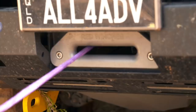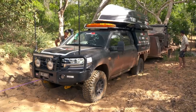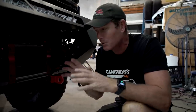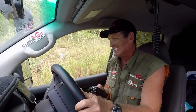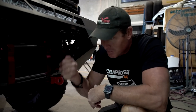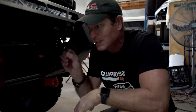Last season we ran the red winch in the 200 and the 79. It's just winding the rope in. Totally impressed with this winch — 17,500-pound winch. It is a killer winch. Its ability to run under extreme conditions. And the weights that we get in these trucks now when we're towing trailers are huge, so your little 12,000-pound winch ain't going to cut it anymore. The fact that it's got extra things like air brakes, air free-spool, remote control, button operated in the dash — all those things make these winches worth the money that you spend on them. They'll get you out when you need to.